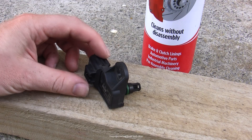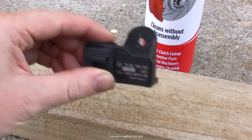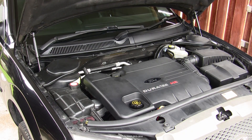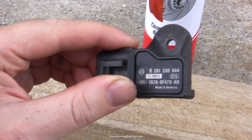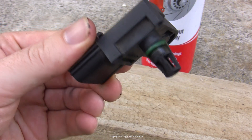In this video I'm going to look at removing and either replacing or cleaning and then replacing the MAP sensor on a Ford Duratec HE engine. On the Duratec it's actually a T-MAP sensor — the T stands for temperature, because it doubles as an electronic thermometer in the Duratec's case.